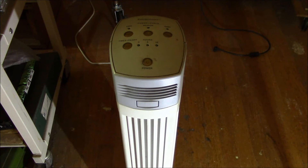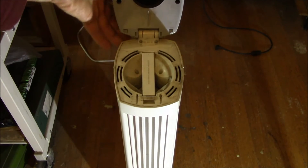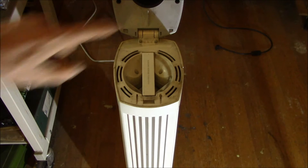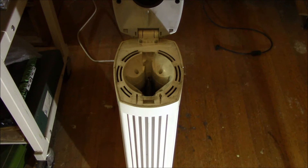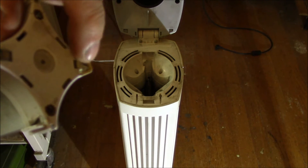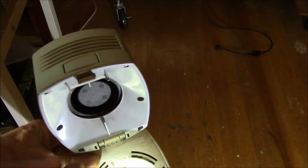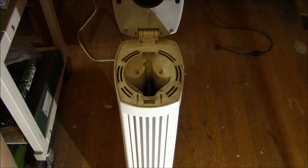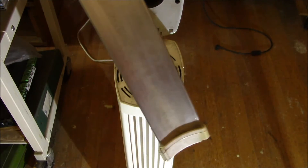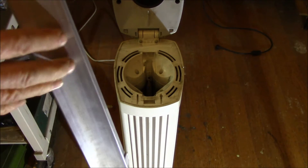Good morning YouTube. I have one of these electrostatic air cleaners — I think it's the Environizer. It's a freestanding unit and pretty simple inside. There's a fan up top, a little squirrel cage blower, an aluminum extrusion section in the middle, and down at the bottom there's a couple of contacts. There are four little wires that run down and actually ionize the air as it gets pulled up the column, and this grounded metal part causes dust to hit the surface and stick.